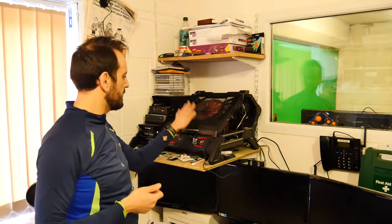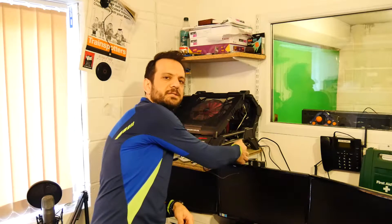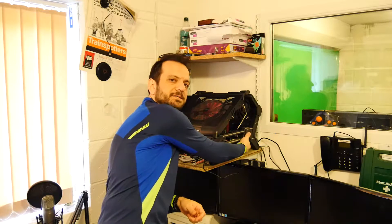One of the benefits of this case - it's an Aerocool, I can't remember the exact model, I'll put it in the description below - is that you can just get in there nice and easily. One really cool feature is that underneath you can actually get to the screws that mount the heatsink for the CPU. So even if you have to do a CPU fan swap with a different footprint, you can get in there without taking the motherboard out - that's really awesome.